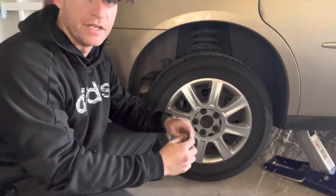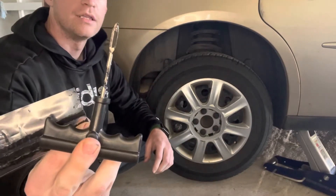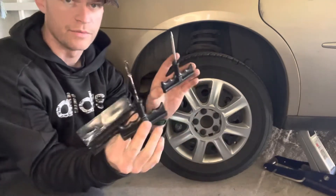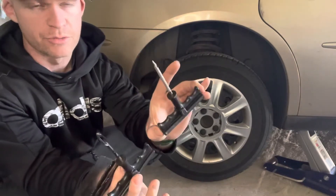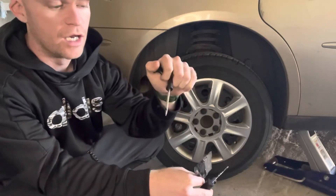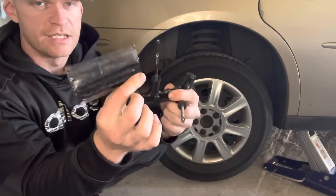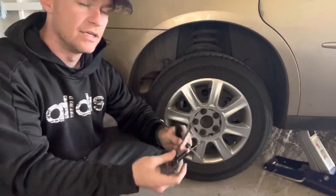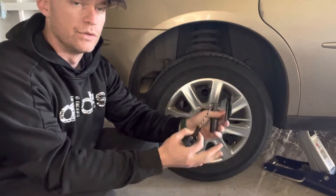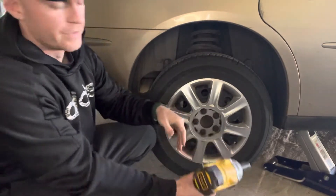Before I start, this is what a tire plug kit looks like. This tool is what's going to plug the tire, and you need this other tool also. This is what comes in your normal kit. This is what you're going to insert first into the tire — I'm going to show you when I pull it off. You need to ream the hole out so you have a clean surface to put one of these plugs inside. Then you'll rip it out. It might seem confusing but it's very easy to do, so let's just go ahead and do it.